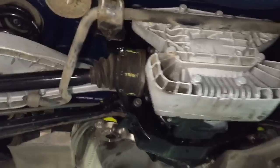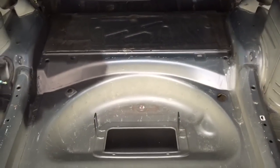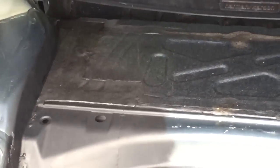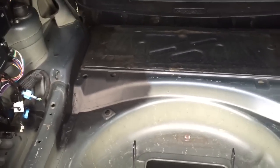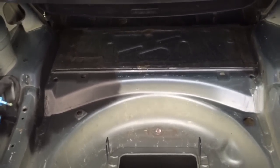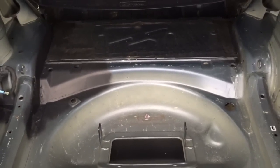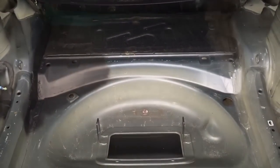And we're just going to continue now and put the rest of the under trays on and in the exhaust system. So I've replaced the sound deadening pads now on the rear axle carrier panel. Left rear up there, blended in nicely to the original panel. Replace the ones down the front of the seat area where we've done, and the one on the right hand side as well. You just see the covering panel there that we welded back on after cutting it open to access the cracks inside that left rear cavity. And now the boot's been vacuumed out and also panel wiped and degreased, ready for the next stage, which is a little bit of paint colour.